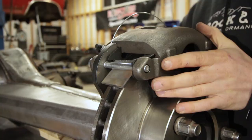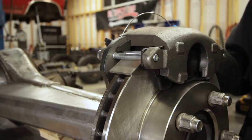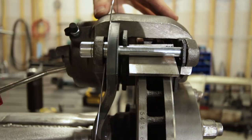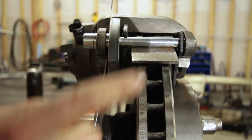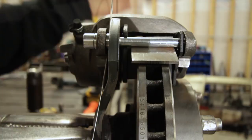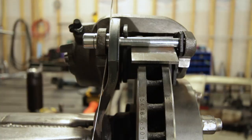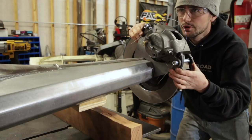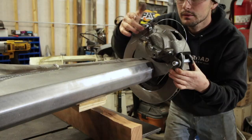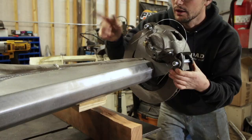We'll decide exactly where we're going to put this and tack it in place. Make sure your bleeders are tight, and then blast a little bit of compressed air inside this port. You can kind of see the whole thing shift — what that did is move the inner pad over as if it were braking. Now that it's clamped on the rotor, verify the pin is nice and level to the rotor, spaced off with our eighth inch pieces front and back. Now we can rotate this whole unit to the desired location — I just want to make sure that either one of the bleeders is above the piston so I don't have air trapped when I bleed the brakes. That looks about good, and I'm just guesstimating on pinion angle.